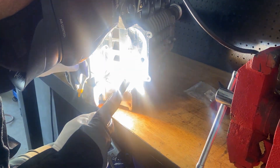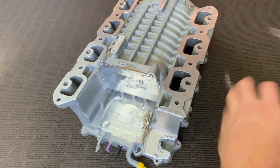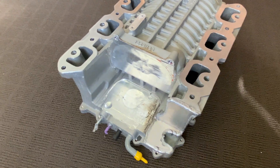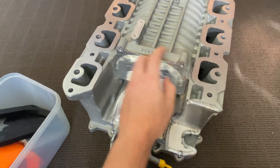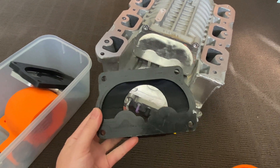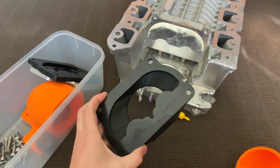I had been toying with the idea of deleting the bypass valve altogether, just for ease, to have more room to swing the intake out to the left side of the car and out of my line of view. Here are the trials I made — I basically sketched up the flange that goes onto the supercharger itself and came up with this. You wouldn't believe it, but it looks symmetrical and it's not — the bolt pattern looks the same but it's a few millimeters out here and there, which was frustrating.